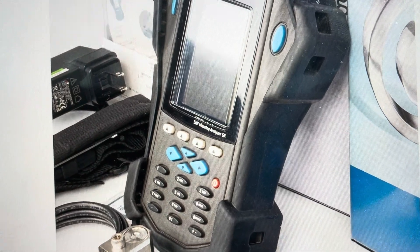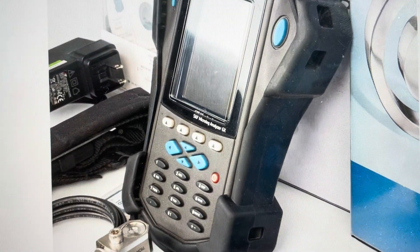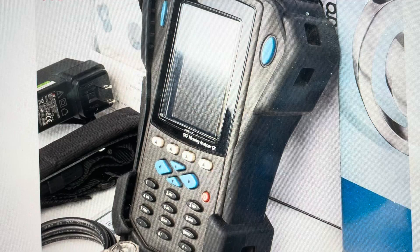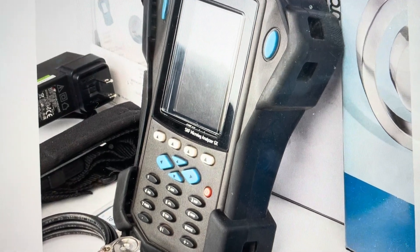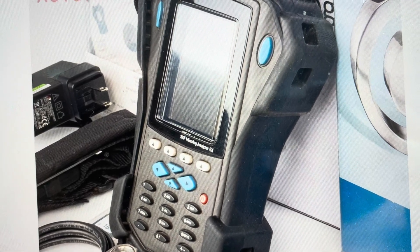So if we want to do that, all we need to do is come in and press on the numbers dial. We're going to press 2, 7, 8, 9 — all four of those buttons simultaneously — and press and hold them for about a second or two. After about a second or two, it will turn the machine off and then it will turn back on with the display screen, starting back up just like it's starting up from being turned off.